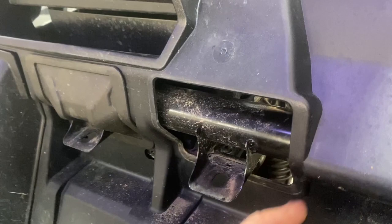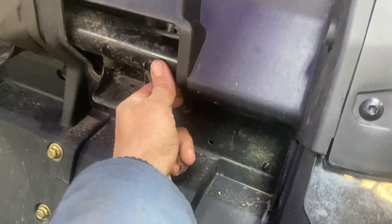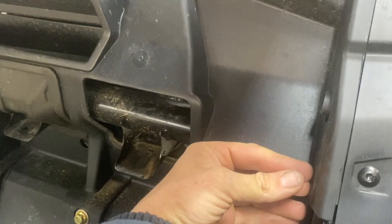Run your cable along the back side, plug it in, and run your cable back down. You can take this little cover off — just a screw on each side, pull it off. The manual instructions say to run it behind that frame tube right there. The way you do that is basically pop out this little rubber around the seat belt and feed the wire through there. Then you can take a pry bar or something and pry out on the plastic and scoop the wire in so it fits better.